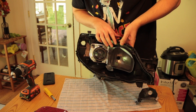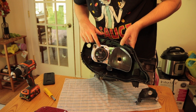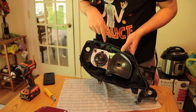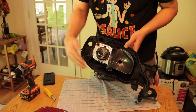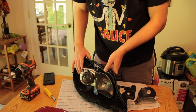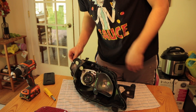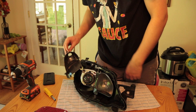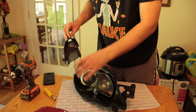While taking this apart, I was trying to take this part of the lens out, but it's all one big piece along here. I undid these four screws thinking it would take it out, but it's still being held in by something. Like the first time, I'm just going to mask around the projector and put a bag in here to make sure nothing gets covered. These right here are just your side marker lights — there's a screw here and one down there — and there's also a little orange amber reflector that comes out with them, both attached to the same set of screws.